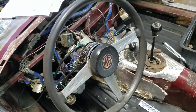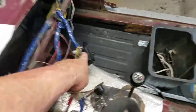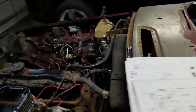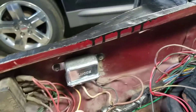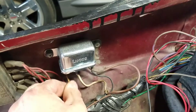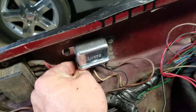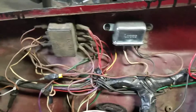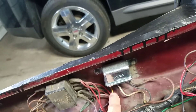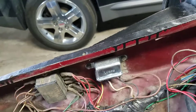Half my brain is fried looking at those wiring diagrams. We now have that spliced. What the previous owner had — he actually had that wire going to the starter relay, and he had this yellow and brown wire with the starter relay hooked up live. He didn't bypass the Pertronix box, he just left that laying there. I'm thinking that was maybe the reason why I wasn't getting any spark.